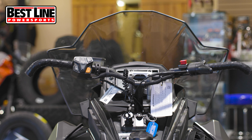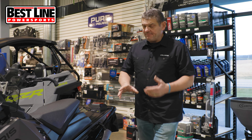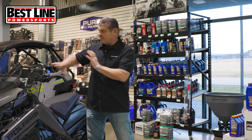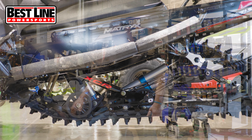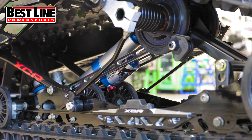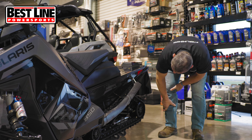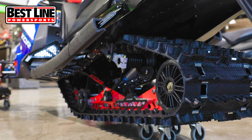I'm going to go over the XCR advantages. Everybody questions me: what's the difference between the XCR and a VR1? We already talked about the Walker high-low shocks and the bearings in the shock ends — that's one of them. Underneath here, your jack shaft that runs from your secondary clutch over to the chain case is a solid hardened jack shaft on the XCR. Down here, these are heavy-duty rail beams on the XCR over the VR1. You have transfer blocks with the cross shaft, which gives you rigidity support between your rails — the VR1 does not have that. You have a heavy-duty front torque arm, a fourth idle wheel in the back — the VR1 has three.